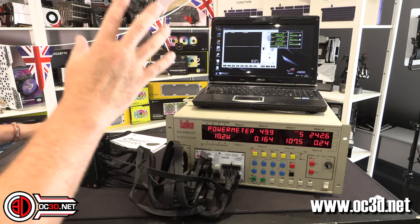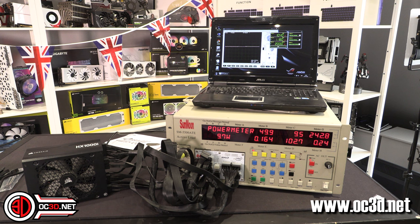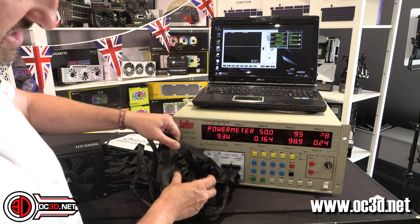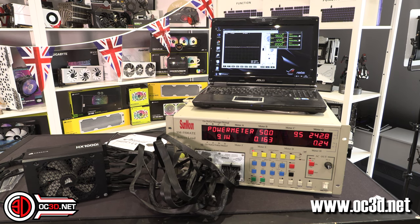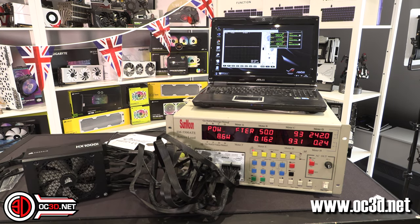Looking at the cables — most of them are flat and black. You get a 24-pin with some braid, and three EPS connectors. One thing I found a bit strange is that the PCIe cables are all daisy-chained — there are no individual PCIe connectors. Some graphics cards require a single cable every time, and with cards now having three connectors, you could end up with a loose daisy chain. I really wish it had come with one or two individual 8-pins — and honestly that's my only gripe.